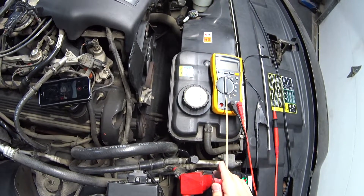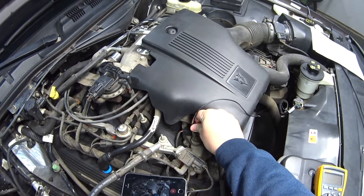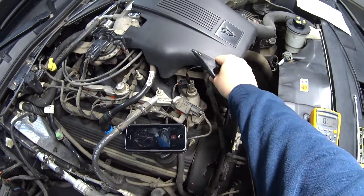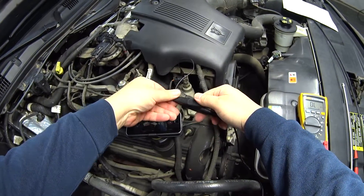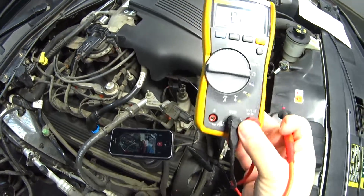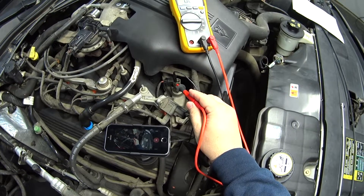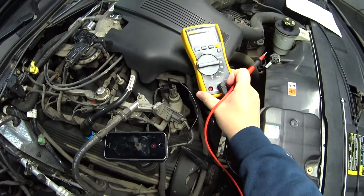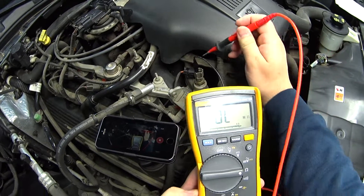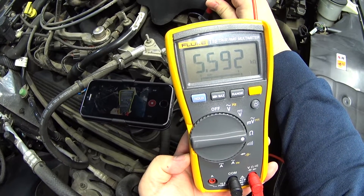What we're going to do is get our meter and do a resistance check on the sensor. I'm going to make this a little bit easier on myself and use a little alligator clip. I've got my meter set to resistance and I've got one end of the probe connected to one pin, and now I'm going to touch the other pin. My reading is 5.5 kilohms.